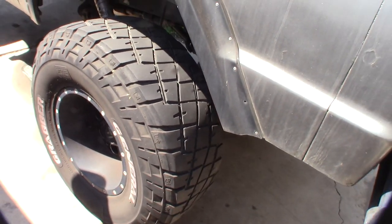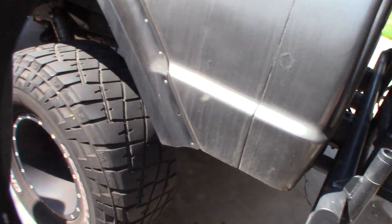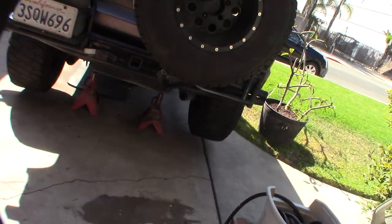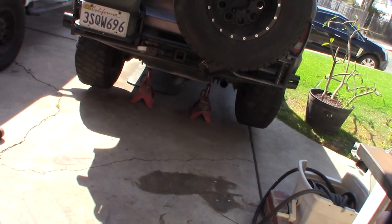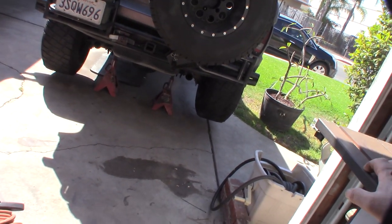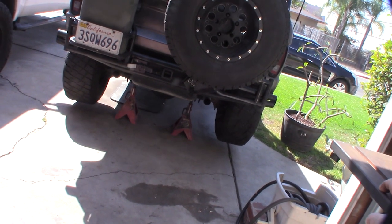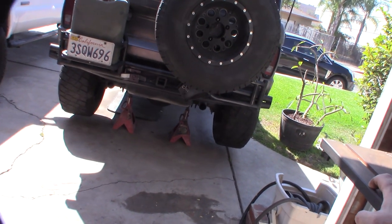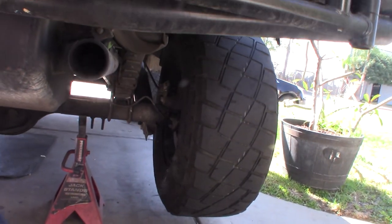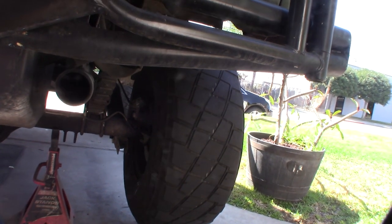Yesterday I started noticing it out loud. I could smell it, and it had been happening for like a week. It would kind of come and go, intermittently locking up I think. I was looking down, didn't see any leaks, and finally tracked it down with my thermal gauge and decided to check the brakes. The smell was coming from the back of that hose fitting right there - I could see it bubbling and smoking off the hose fitting.